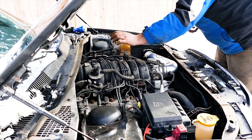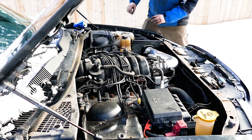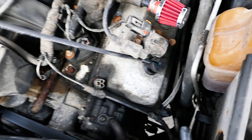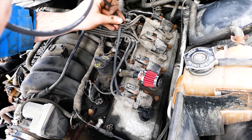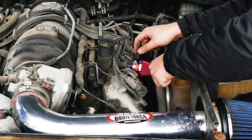Since you're replacing the spark plug wires one at a time, everything should fall into place the same way you removed the old spark plug wire. When you get back to the other side of the Hemi, install the spark plug wire end with the longer boot connector into the spark plug housing and press down until you hear and feel a distinct click when you make the connection. Congratulations guys, you replaced one spark plug wire.